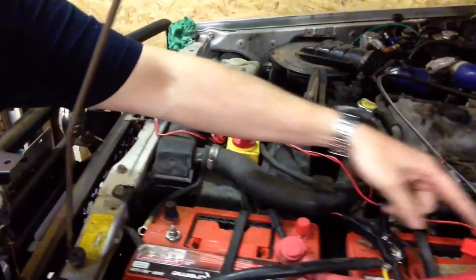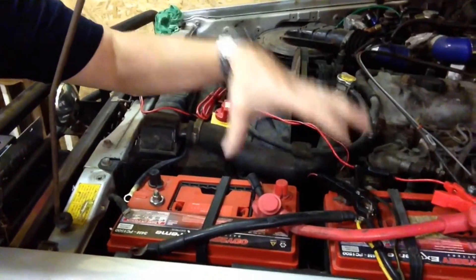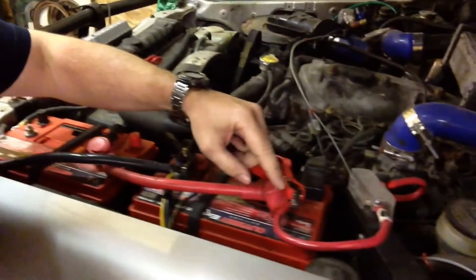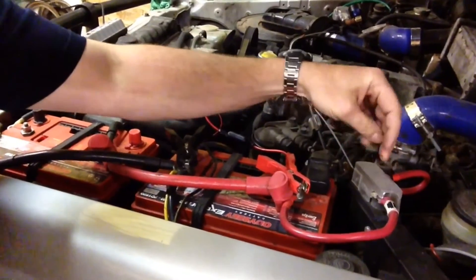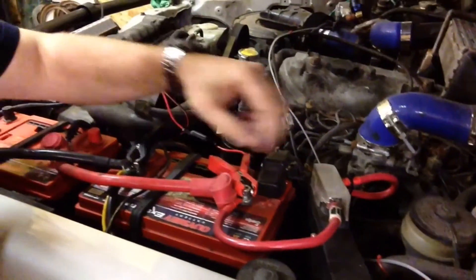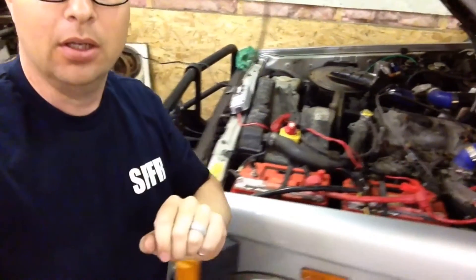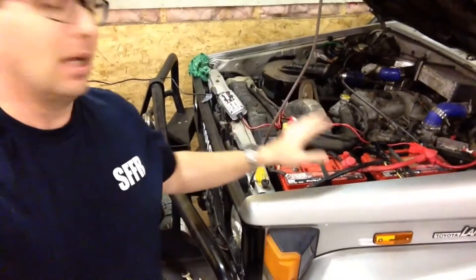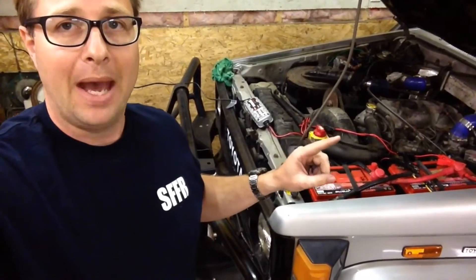Now these two are not isolated from each other. So if one goes dead, they both go dead. These are both the starting batteries and the batteries to run the truck. Farther back here, you may see this line here - it comes off my positive post and runs to a fuse, and this then runs through an isolator which is in behind here. That runs to the back of the truck where my true second battery is. Even though it's a third battery, it's my second battery system - an isolated battery separate from the batteries that run the truck.